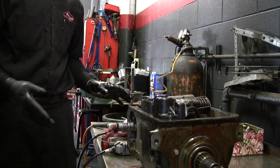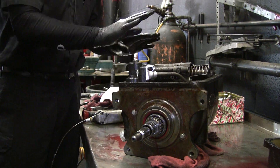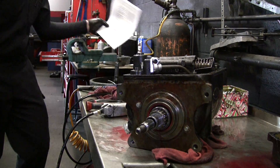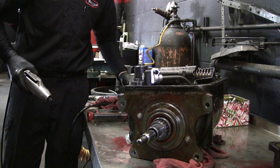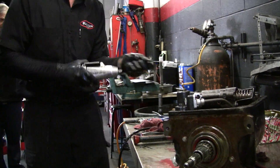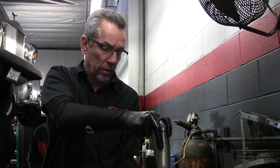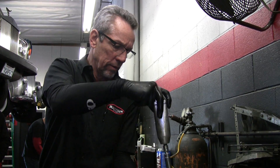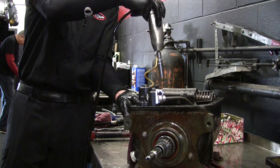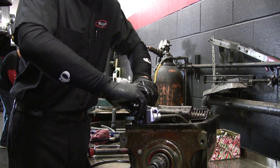So I showed you how those things work. If you're just changing the front pump or the seal, you've got to pull this front servo off, and to get the front servo off you've got to pull the rear servo off with it. These kind of almost come up together.